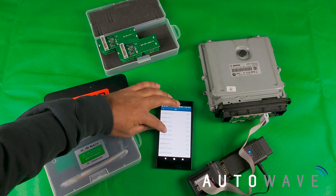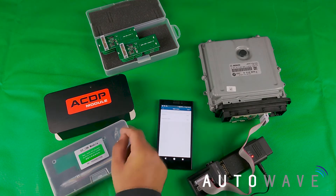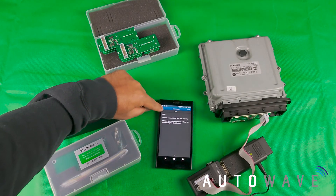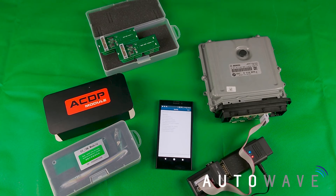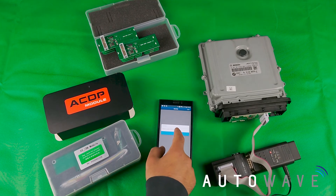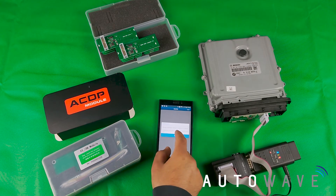Going to that ECU on the app — very important to have a good quality internet connection. I'm going to identify the ECU; there are always help menus available. Starting the connection now. You can see at the bottom loading program 100%. It's logging into the system and trying to identify the ECU. As you can see, the LED has come on — it's red — and there's the hardware number and series number as well. So we know we've got communication.